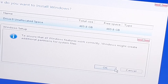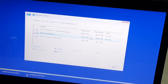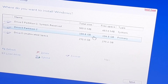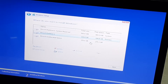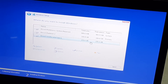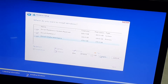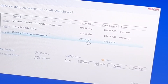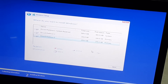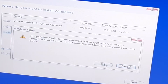Click Apply, then click OK. There we go with the partitioning. We have three partitions now: System Reserved is number one; number two is 194.8 GB — that is my C drive; and number three is unallocated space with 270.4 GB. Click New again to make it ready for use. Select and apply. Don't forget to format — if you don't format, after installing Windows you won't see the drive. Make sure you format it.